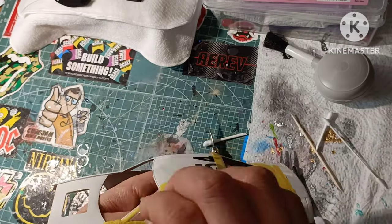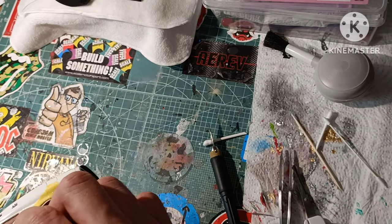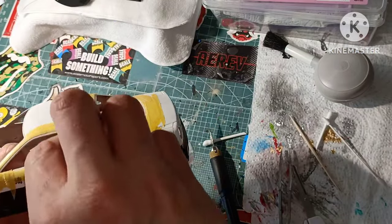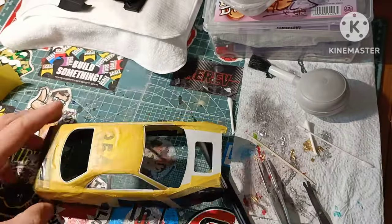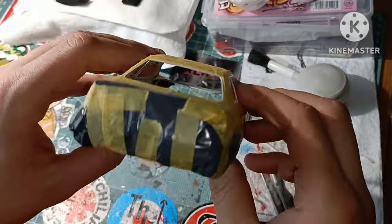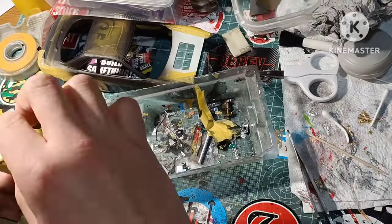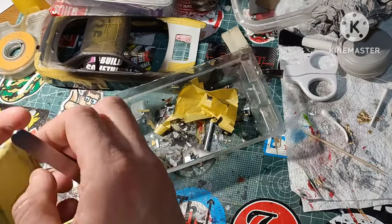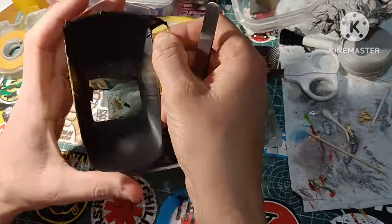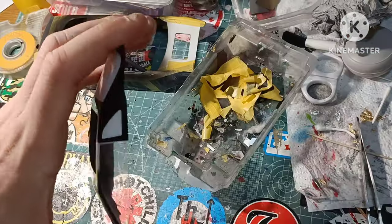Just a quick one as well: once I've masked it off, just to take a bit of the shine off and smooth it back a little bit — as you see there, there's some P800 sanding sponge from Street Blisters — just to take the shine off and give it a bit more of a keyed area so the paint goes down better. What I've used to mask off the larger areas is just a plastic delivery bag, leftover from deliveries. It does the job well enough.